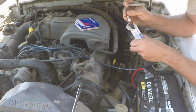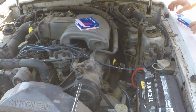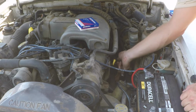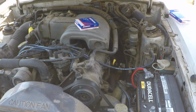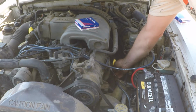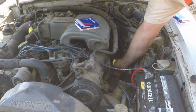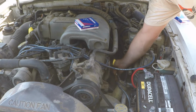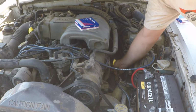Like that. So that as we're working on this thing, we can determine if we've got an injector problem, because if we've got certain cylinders, certain injectors are, say, not delivering sufficient fuel, those cylinders are going to show up as lean. And since the O2 sensors are in the collectors after the at least 4 cylinders, if not all 8, going together into a single exhaust.